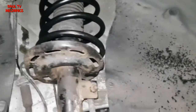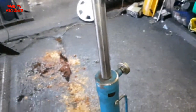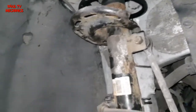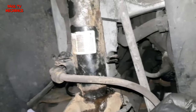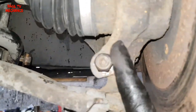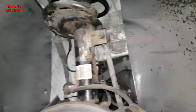The spring is back on and the shock absorber is back on — everything is on. We need to get it through there up to that mark, so I've got the gearbox hoist on it. I'd recommend two people to put it back: one person to hold it up and another to get the top nut on. Jack it up and it should lift up into position. The shock absorber's back in — bolt back in, flexi pipe back on, ABS wires fed through, drop link nut on. Put the ball joint pinch bolt back on and finish it in reverse order. Don't forget to put the wiper arms back on.